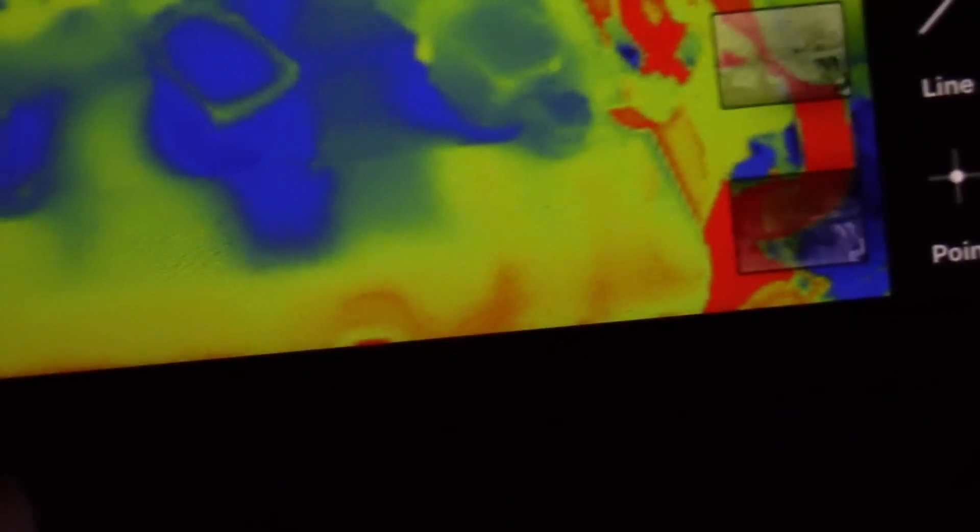We want the circuitry working because the thermal camera may still pick up continuity through the coil. Using the P2 thermal camera, I'm hovering over the four ignition coils, and we can see that the third ignition coil is absolutely cool while the others show some warmth. This tells us it is absolutely an ignition problem — either a bad coil or we're not getting proper power, ground, or signal to that coil. Another indication: looking at the exhaust manifold runners, the number three runner is noticeably cooler than the others, indicating a lack of combustion because there are no hot combustion gases coming out.